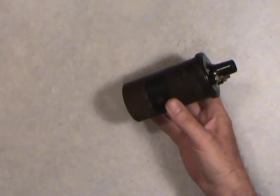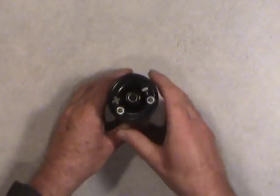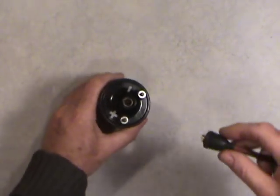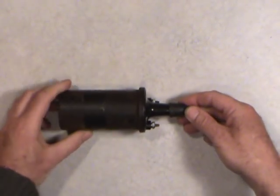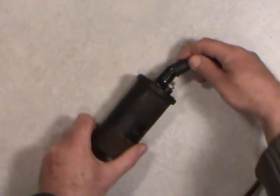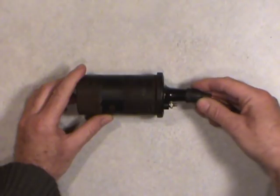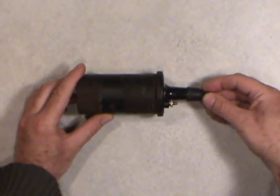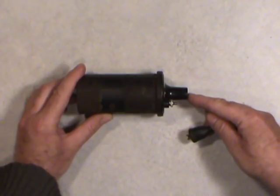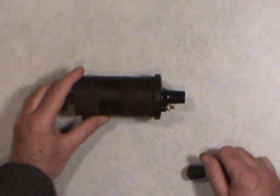The reason I've got this one as a sample is I actually had to take it out of service. This one is mounted horizontally, not up and down as per usual, and when I was checking connections and took the high tension lead out that leads to the center of the distributor cap, there was some oil leaking out of the end of this tower here.